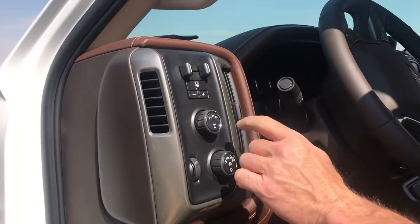One of the tricks I do — backing on or pulling forward — is I come inside my truck and if you have a four-wheel drive, I go to four-wheel low. The reason you want to be in four-wheel low is it's really going to move slow, so I get a nice, controlled movement onto my camper levelers. So let's give it a go.